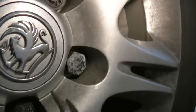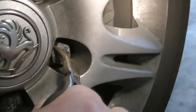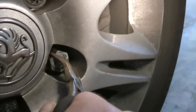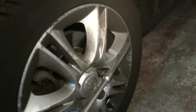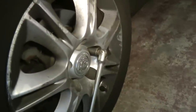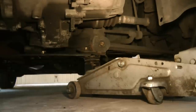To remove the plastic nut caps just get a pair of pliers, get hold of it and give it a little wiggle, and just pull it gently and they come off. Make sure you loosen all the nuts before you jack the car up, otherwise you won't be able to undo them. The best place to jack it up is where the wishbone is, where the bolt goes through, just underneath there.